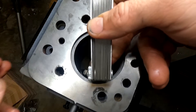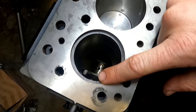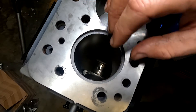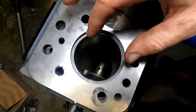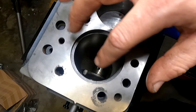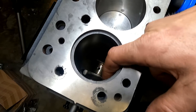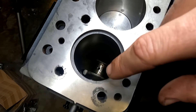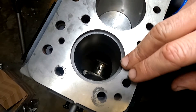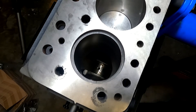It's definitely not going to go. This is a gap you want to make sure you check against specifications when doing this sort of job. If the gap is too small, as the piston heats up it creates friction — friction creates heat which creates expansion which then closes the gap. If it's too close they're going to touch, bind, and damage the cylinder walls. If the gap is too large it's going to let too much blow-by and more importantly allow oil into or out of the cylinder. It's definitely not good, but it's something you need to do when rebuilding an engine.